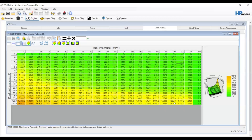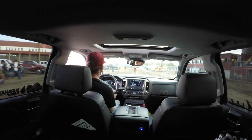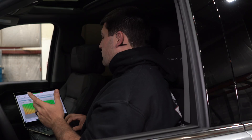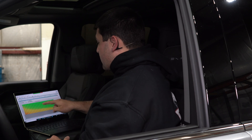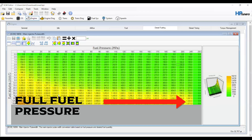A cap of what we don't like to go over, depending upon the injector and the type — LML is a little bit less, L5P we can go a little bit higher, same thing with the common stuff — it's usually about 3,000 to 3,200 µs. At that point you're in a full-blown competition truck, really asking the most out of that injector. So the way the truck moves through this map, what you would see as a spreadsheet, is more of just a diagonal line here. You're going to be idling somewhere around typically between 8 and 12 MM3 with your fuel pressure, wherever that may be, between 5,000 and 7,000 PSI. And then you have full fuel pressure out here, so you're going to see this pathway the truck's going to take.